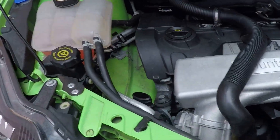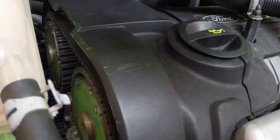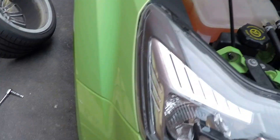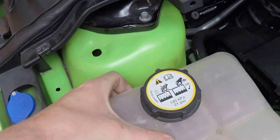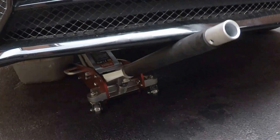As you can see I've taken off the cam belt covers just by loosening the two bolts in the top and wiggling it all out. You have to release the engine mount as you can see here. That's not too difficult but it does involve taking off the coolant tank which is just held on with clips, so you just lever that off - it's quite easy. Make sure you've got the jack underneath the engine to support the weight.